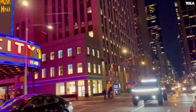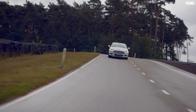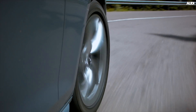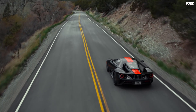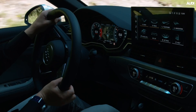What's incredible is that Tesla have managed to make this body shape more aerodynamically efficient than the smoother shape of a typical truck. For a normal road car, designers focus on reducing drag, which improves fuel economy, electric range, straight-line speed, and reduces wind noise. Sports cars tend to suffer as they seek to produce some downforce at speed. But while downforce is unnecessary for all but the most serious performance cars, normal cars do have to consider it, because most cars actually produce lift at high speed — the shape of the car can begin to work like an aeroplane wing, making the car feel unstable. So cars do have to have some element of downforce to reduce this effect.